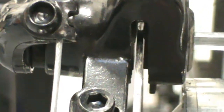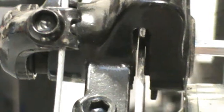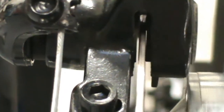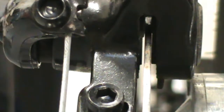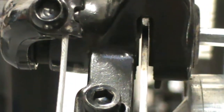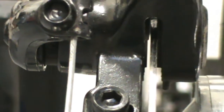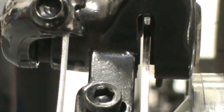If I turn this clockwise, you'll see the brake pad start to make its way in towards the rotor. What I'm doing is trying to look through the camera to see how much space I have left. If I take out the allen key and rotate the wheel — you can see that it's dragging and making noise. We're not getting a full revolution. So I'll just take it back a quarter turn with the allen key. There's a bit of daylight now — that's what you're looking for. Hopefully the wheel will turn freely without making noise.